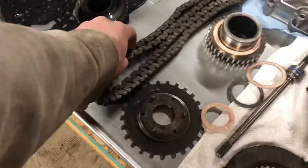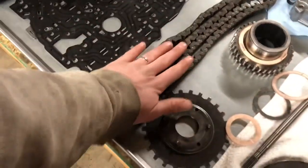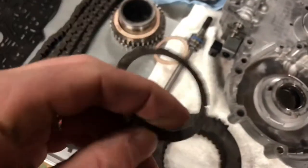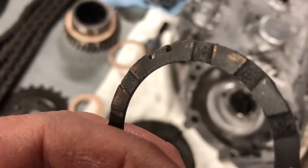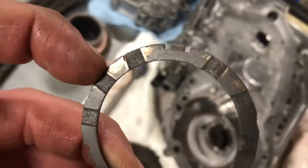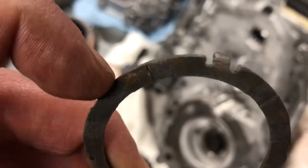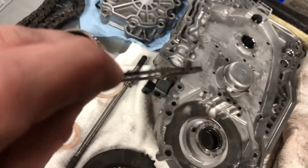The chain had a lot of slack, but they said they rarely replace them, and honestly I think it's going to be good to go for our situation. Our little thrust washers are looking good — the lower part is the rougher looking metal and the top part is kind of a brass-ish looking thing. I probably would have wanted to replace that, but you can see it's just starting to wear right here. When this brass wears down to that level, that's when you start getting in trouble.